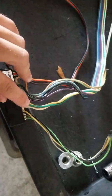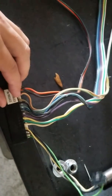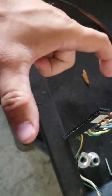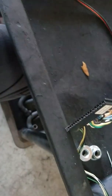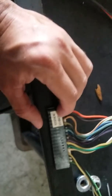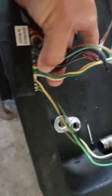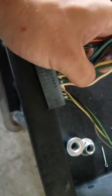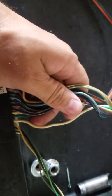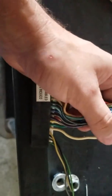This right here is your wiring harness coming down from your turn signal switch. This plug hooks up to a bigger block, which becomes a part of basically the end of the steering column. This white wire right here is a feed from the brake pedal switch, so whenever you push the brake pedal, this should get power.